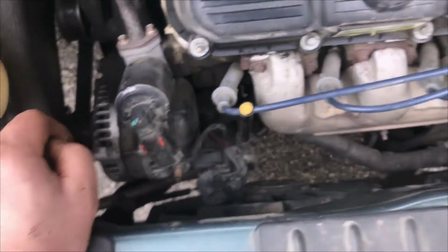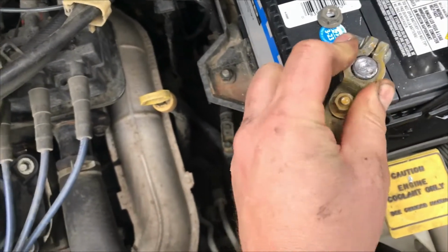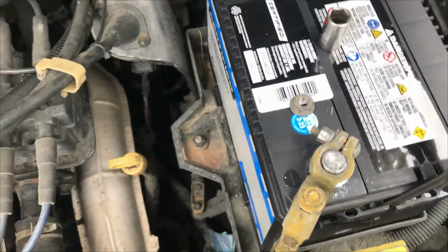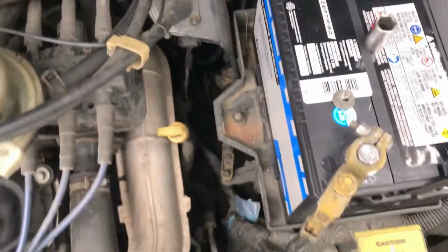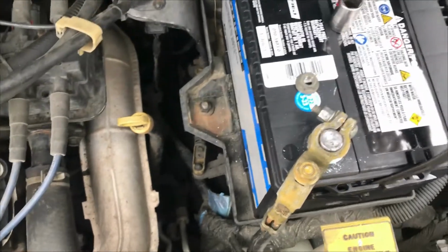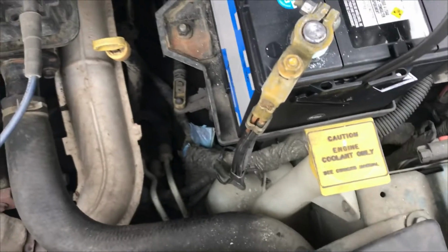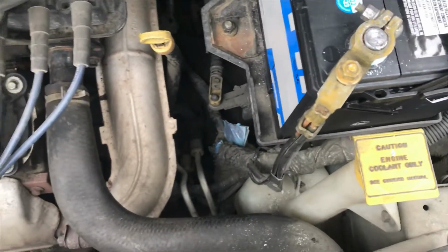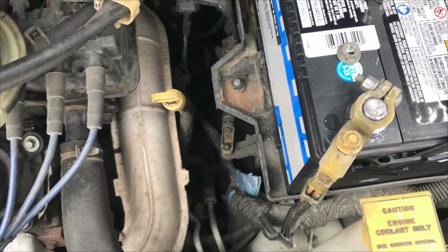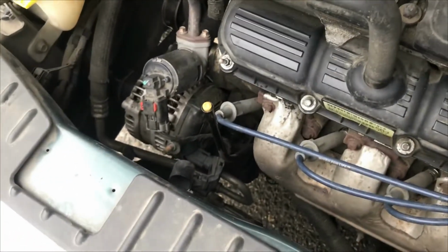sometimes it is. Anytime you're hooking up a terminal to a battery, say you do a big job or whatever, keep an eye out for the level of sparks. If you leave the key in the on position, you'll get a little bit more. But I've had a few times where it seemed excessive, and I went and grabbed my amp clamp with a meter to make sure what's coming out of there is a reasonable amount, or whether I accidentally forgot to hook something up and something's touching something that shouldn't be. But anyways, in this case, it's just that simple. It's just going to need an alternator.